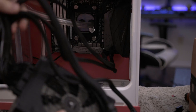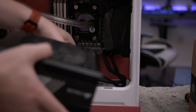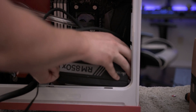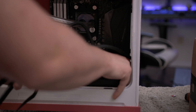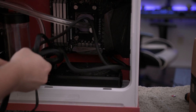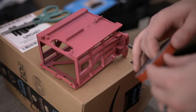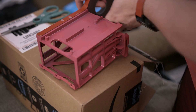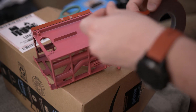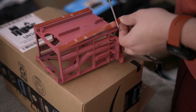Be mindful of your cables and just go ahead and drop the PSU in. I did have to take out the water line between the CPU and the pump, so just be mindful because you're going to end up redoing things two or three times with something like this. Keep the PSU as close to the door side as possible and jam the wires back out of the way, push it down, and start managing the cables. One more thing I forgot was to put the double-sided emblem tape on the hard drive cage and get that installed, but I checked and we'll be able to weasel it in with everything installed. Just going to add a couple of strips, peel off the adhesive cover, and we should be good to mount.